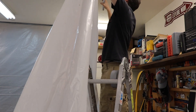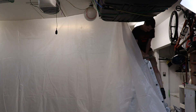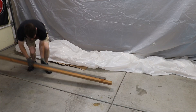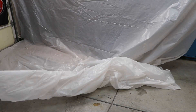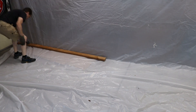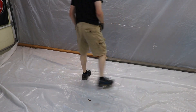Here I'm creating walls for the area I want sectioned off from the rest of my house. I want those fumes to be able to exhaust out the front and not go into the house. Now that I've got the top secured, I'm going to bring in a couple of 2x4s — these will help define the wall. I left enough extra on the plastic that it'll actually drape underneath my vehicle. I'm going to put these boards along the edge of the wall, which helps keep the plastic from moving around and creates a nice wall.